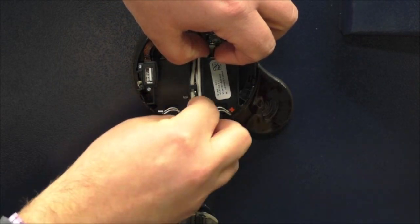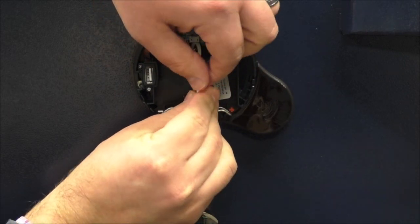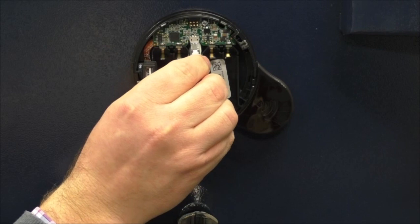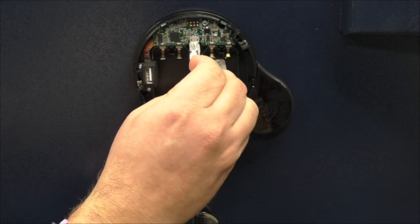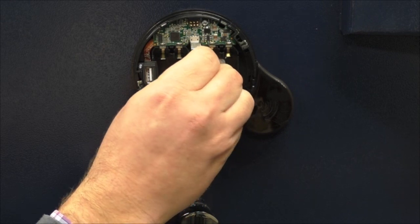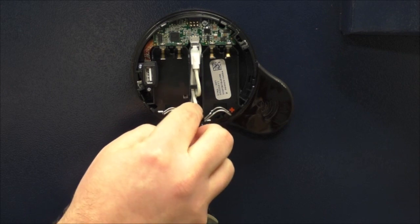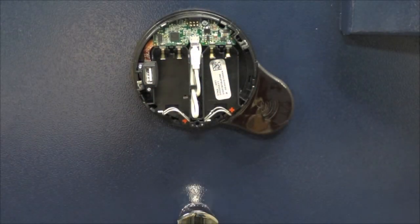The cable will go down and once you bend the cable to go back up, the cable plug should align with the mini-USB connection. Once the connection is made, adjust the cable to rest lower than the cable channel walls. When adjusting, try to avoid direct pressure to the cable connection. Excessive force could damage the connector.